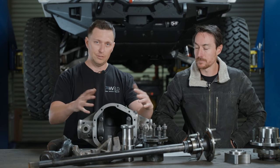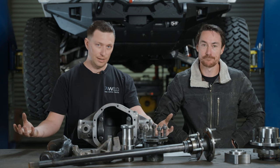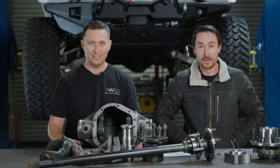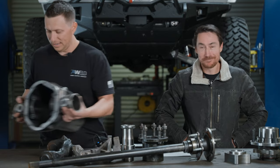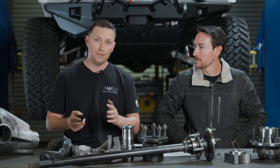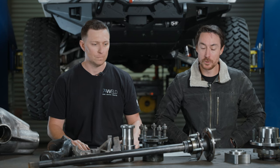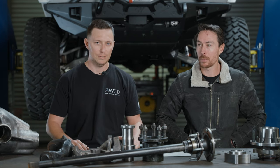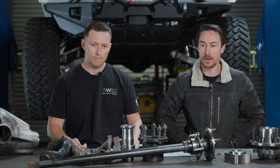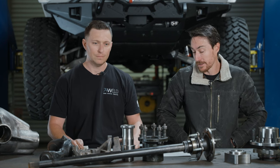The first big piece of the axle is the center section gearbox, which is also what holds your tubes in place. We don't have a tube up here, but it's pretty simple — it's a piece of steel with a hole in it. In common vernacular it'll be outer diameter, thickness, material. Tube is always measured by outside diameter; pipe is always measured by inside diameter. We use tube in all of this stuff.